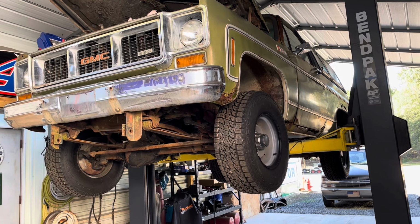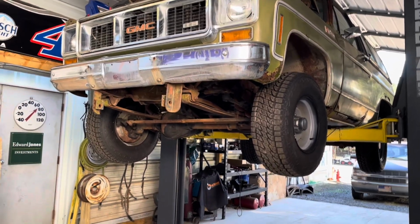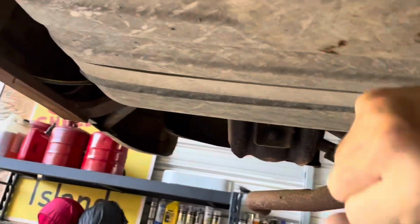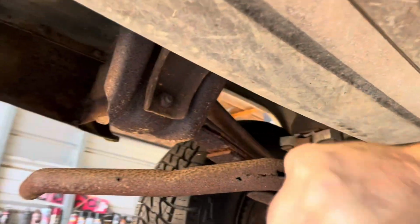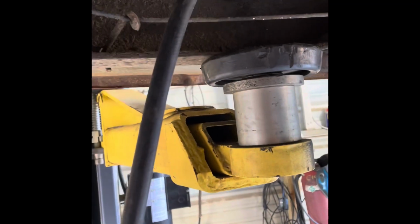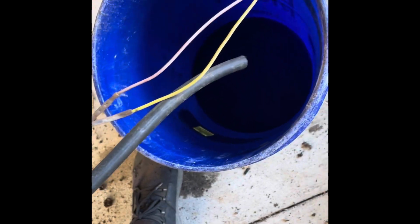Dumped some fuel down into the fuel pump from the fuel line where I took it loose at the carburetor, and the pump pumps that back out. So I think the pump is probably good. It's a possibility that there's no fuel in that tank, or, I mean, it's just so hard to tell. It really does sound empty to me. But I'm gonna take the feed line loose right here, put a fresh rubber hose on it, and see if I can siphon any out of the tank. Yeah, there seems to be no gas in it.